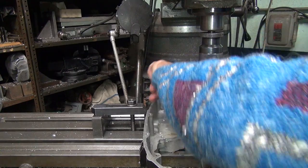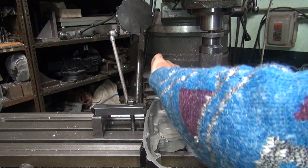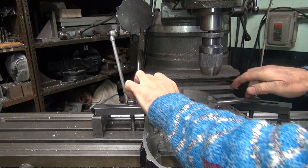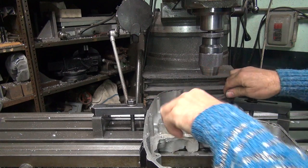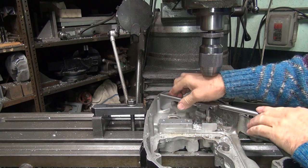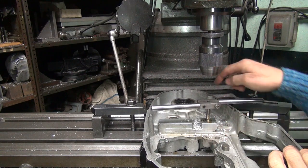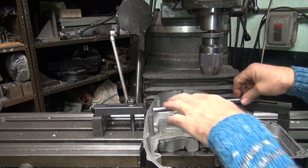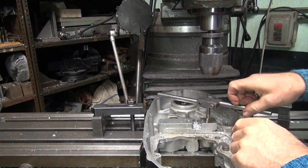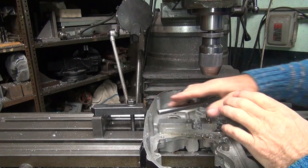We just go down until we feel where it hits a stop. It's getting harder right here, so that's probably a good place to stop. Yep, right there. It's not a hard stop, it's just getting harder to turn. The hole overlaps the inside flywheel cavity, you're drilling in that area, so it's half hole, half not. So if you keep forcing a tap in there, it'll bend over and snap off or bind up and break, whatever. None of that's good. So when you start feeling like it's doing that, stop, don't go any deeper.